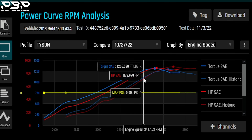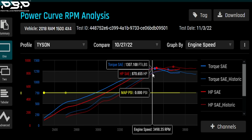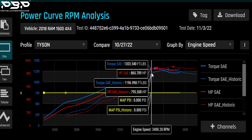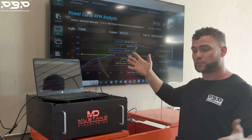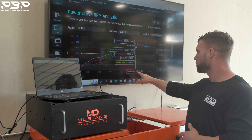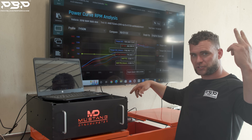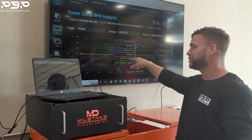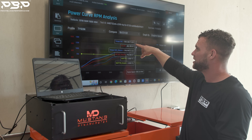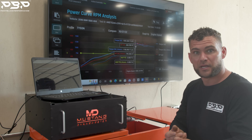Now let's get into some big power. Let's go to 3,600 RPMs and compare apples to apples. Turbo's boosted up, we're good to go. At 3,600, the Mark 2 made 795 rear-wheel horsepower. The Mark 3 we just ran made 865 — about 70 horsepower more at the same exact RPM. What about torque? The Mark 2 made 1,196 foot-pounds, the Mark 3 made 1,303 — 100 foot-pounds more.